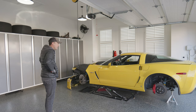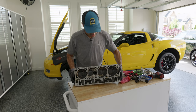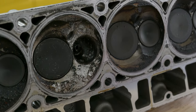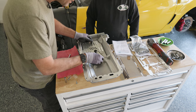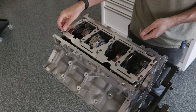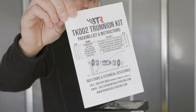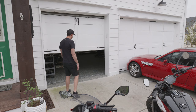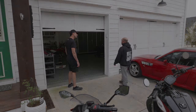At this point in my life, I care a lot more about reliability. Obviously, this time around I won't be using stock cylinder heads, but the exhaust valves are not the only weak point on the LS7. Last time we addressed oiling issues by installing an improved racing oil pan baffle, windage tray, and crank scraper. But before I can really start my engine build in earnest, I'm going to install a rocker arm trunnion upgrade from Brian Tooley Racing. My expert friend Dr. Bobby is back to lend a hand today. Let's get started.